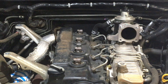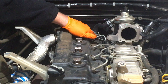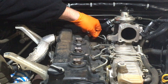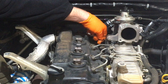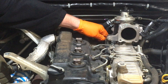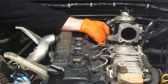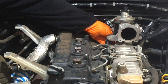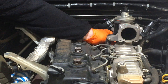Back around the other side now, to get that upside-down bolt — from this side it's easier to access from around here. What you've got to be careful of here — that one's tight. That's what your angle's about, see the angle — it just clears that. The Prado hasn't got that, so you're just kind of clear on that. If you're lucky you only need to get a few turns. I'm doing it one-handed — normally I'd have my other finger in there holding it up. Then I'll probably get in the way of things too much. If it looks a bit awkward, it's probably because I'm doing it a different way. And then you can get it by hand — that's what you want, just a few turns. Sometimes it gets tighter again and you've got to put the spanner back on it.